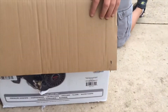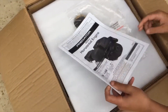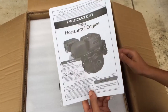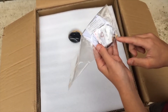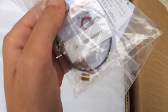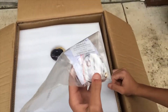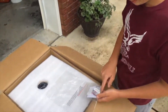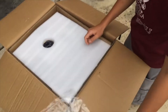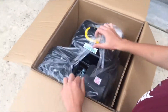So I'm going to go ahead and open this up here — already broken the seal. So we have the owner's manual. You don't need this, it's optional. This is some hardware. So these are actually jets, and you'll see 3,000 to 6,000 feet — that's based on your altitude. The engine was assembled most likely at a different altitude than what you live at, so these are different jets to make sure that the engine is running good, and also the seal for the carburetor bowl. A little foam.